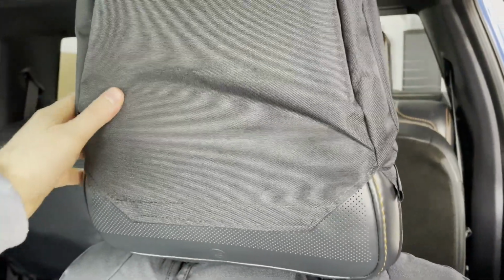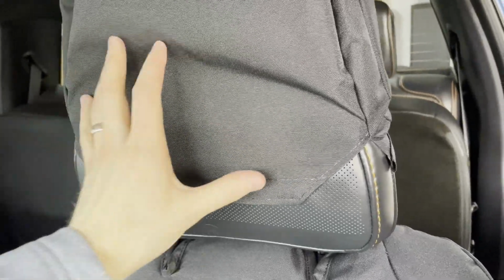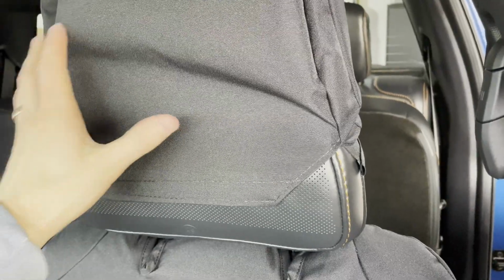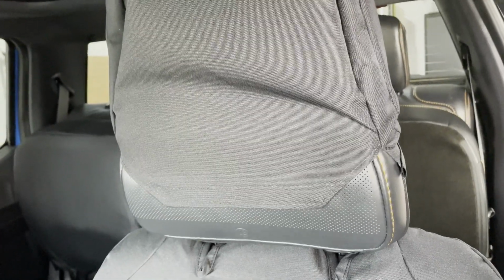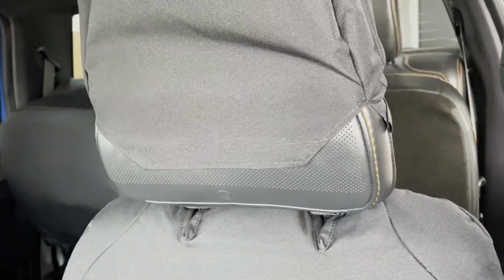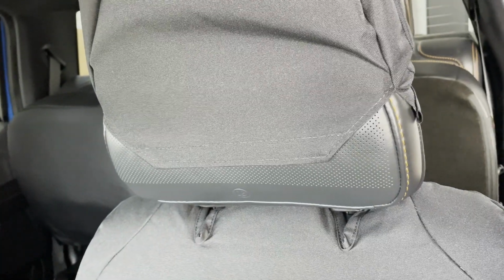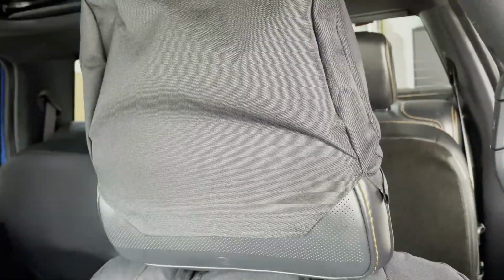Okay, so I've started to slide this on. Now, it's easiest if you slide with two hands, shifting it back and forth and pulling down at the same time. That usually helps when it's in this position. Another tip is move the seat down on your electric controls to give yourself enough space up here to get this on, or else it's really tight to work with. Normally I have the seat up all the way when I'm doing the seat bottom to give myself enough space underneath the seat cushion, but for this part, I move the seat down.